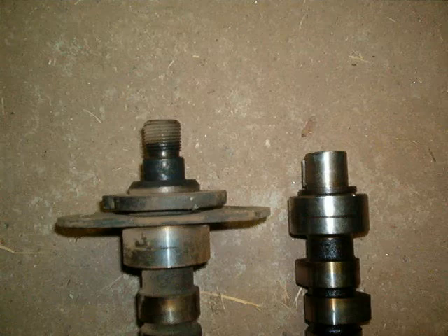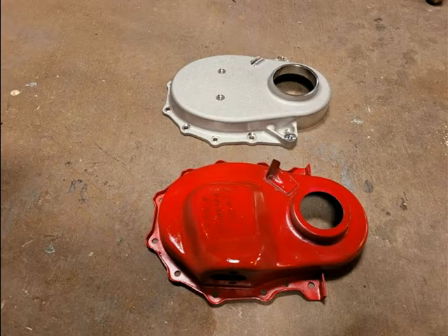There is a wide variety of new cams available for the Chrysler Hemi, to include roller cams. And most, if not all, the new cams for Chrysler Hemis have the short nose. As mentioned in a previous video, at this time I don't know of any new cams being produced for DeSoto and Dodge Hemis. The style of cam you choose may dictate the timing cover you can use.